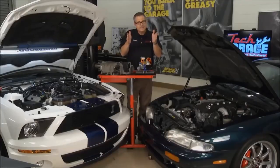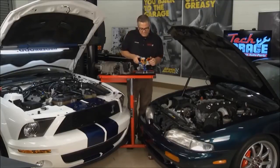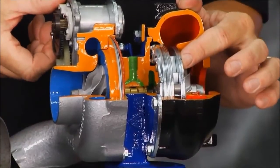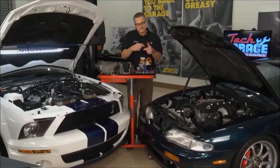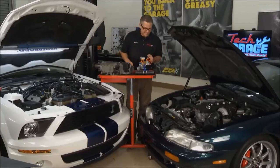If I blow through a wider space, not so much. So at low speeds, we can go ahead and close those vanes, pressurize the air, and avoid turbo lag. What's turbo lag? Well, it takes a little exhaust to get this thing spinning. And I'll show you right here on our 240SX.